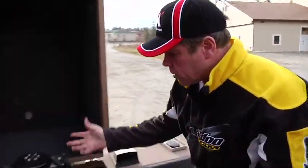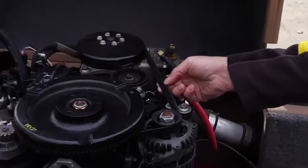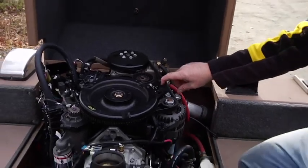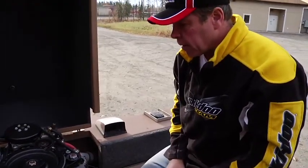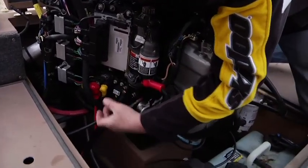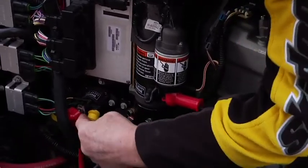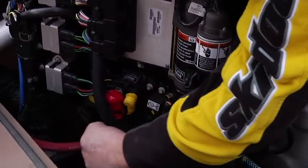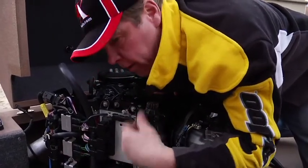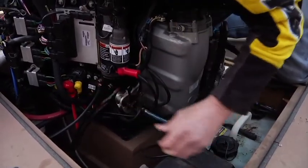On the other side of the engine you have your alternator, which charges your battery, along with the air handler and alternator belt. I've never had to replace one, but it's like a spare tire — they are available. On the opposite side of the motor are mostly electronics: your starter motor, starter solenoid, fuses, and relays. The electronic portion has been bulletproof. Occasionally check that you have a good connection — check your solenoid and the red solenoid wire, because on a direct injected engine a loose cable or loose ground can create running issues. Check your grounds occasionally.